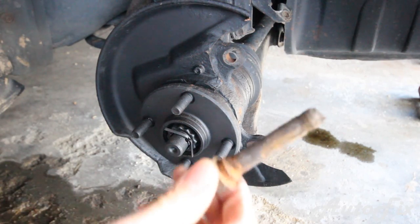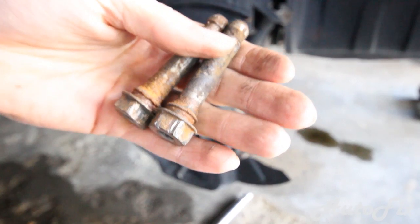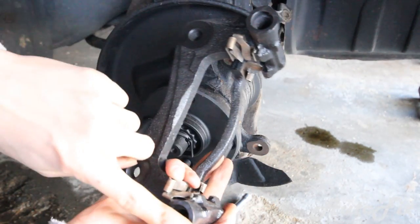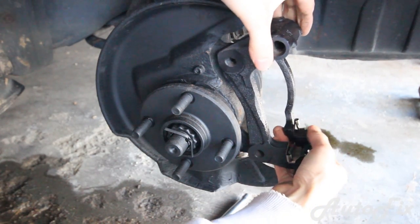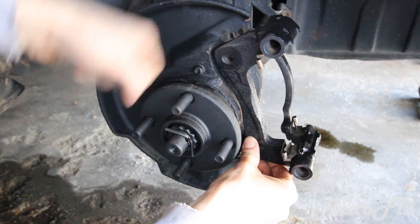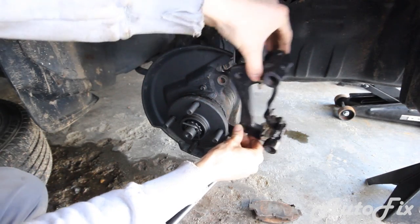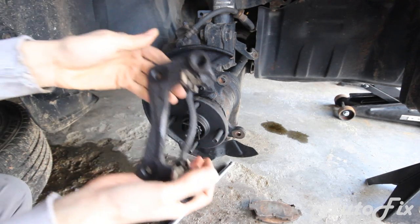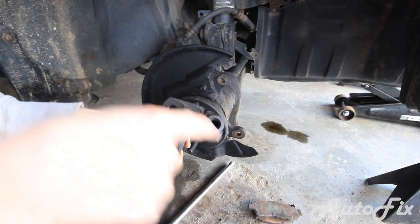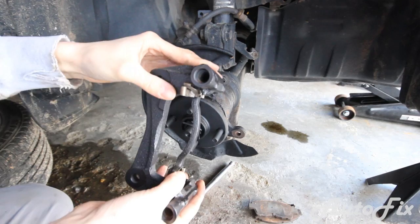The guide pins are very, very dirty — I need to clean and recondition them to use temporarily until my new ones arrive. They were stuck, so I bolted the bracket back on backwards and used a breaker bar to twist and loosen them, then with vice grips I slightly wiggled them back and forth while pulling toward me. On the top one I also used WD-40 — I tried getting it on the inside edge and sprayed a bunch hoping it would lubricate it, and it kind of did help.